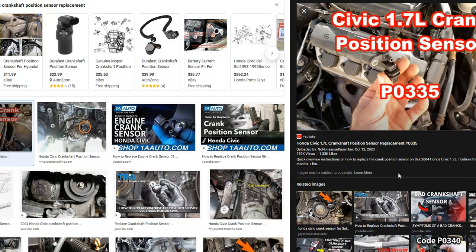Be sure to check for a fuse. Quite often inside of the engine compartment there's a fuse box that'll have a fuse in there, but it can also be inside of the vehicle up underneath the dashboard on some vehicles. After you check all of that, go ahead and replace the sensor, and usually that'll solve the problem. It'll either be the wiring, a blown fuse, a bad crankshaft position sensor, or a combination of those.